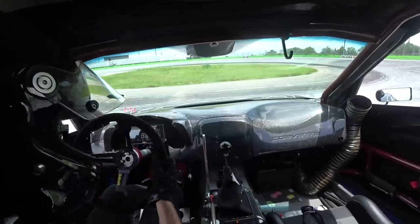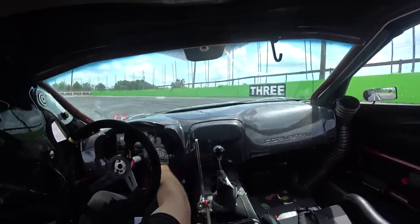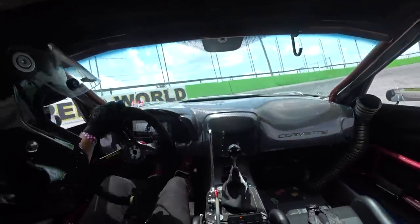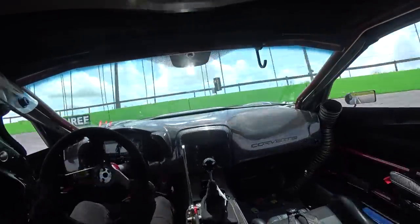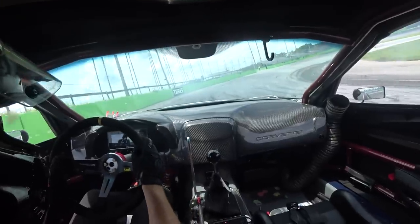So we're now going out on a brand new set of tires, and the scrubs we have are not very good. So it should be a noticeable amount more grip. And as soon as I tip in for the burnout, I notice a little bit of clutch slip. Now, low RPM, lot of wheel speed, could have been an odd thing, but it's not. We're gonna find out the hard way that there's some serious clutch slip problems going on.